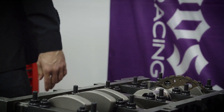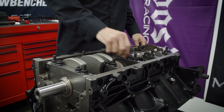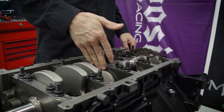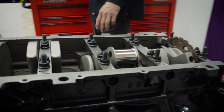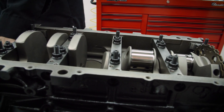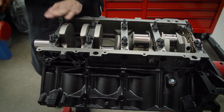You'll notice I left the center cap totally alone — these are still loose. I didn't want to tighten these down yet because we have to now adjust for our thrust. By setting our thrust, we take a rubber mallet and hit the front of the crank, and what we're doing is aligning those two mating surfaces of the two bearing caps.